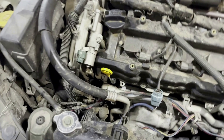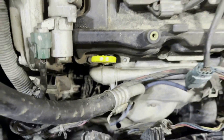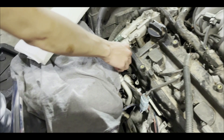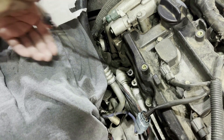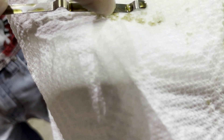We're getting ready to check the oil. This car is very hard to read the dipstick — you just have to get used to it. When you pull it out the first time, the oil will be all over the dipstick and you won't know where to read it, so clean that off and get a second reading. See how the oil is all over the dipstick the first time? Wipe it, then reinsert it. It's right there on the money — I know it's hard to see because it's new oil, but you can see the new oil right there.